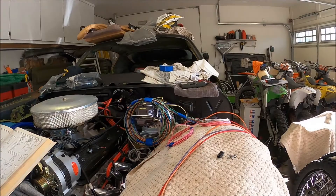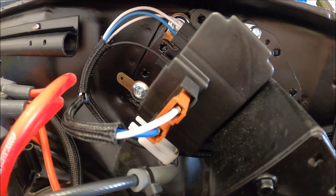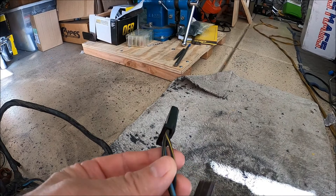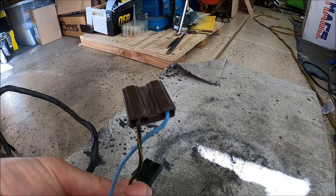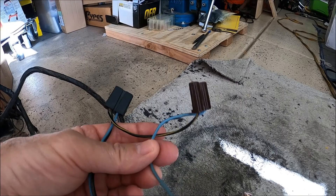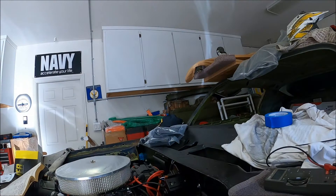You can see the white there — that's your 12 volts in, and it gets jumpered over to the washer. Here's my old harness: it used to be black with a yellow stripe, pigtailed over to the washer. So on the American wiring, this is now white. They also made a distinction between the wiper motor and washer coloring — on my old harness it was the same color light blue, but they went to dark blue for the washer and light blue for the motor.